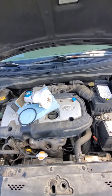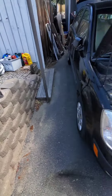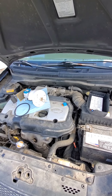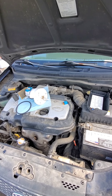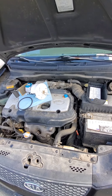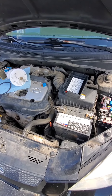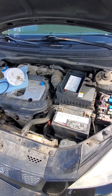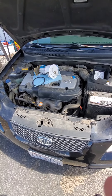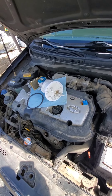My theory was correct. I hooked up a couple of heavy gauge wires — that black one and that red one — and I can hear the fuel pump working. So that tells me it's either not getting enough power or it's not getting the turn-on signal — maybe it's a ground issue. I checked the relay and it's clicking, and I switched relays, so it's got to be in the wiring someplace. Evidently my fuel pump's not bad — it's got to be an electrical problem somewhere.